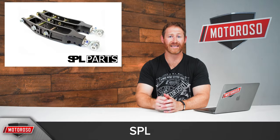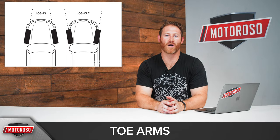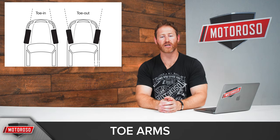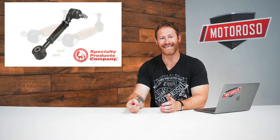The last control arm option comes from SPL, made out of T6 billet aluminum — light and very strong. These provide three mounting options for the sway bar end links and shocks, giving you complete control over the vehicle geometry. They're targeted at high-performance track applications and will set you back around $630. If you've been playing with camber adjustments, you'll also need to make toe adjustments — otherwise the car won't roll right, you'll scrub efficiency, and burn through tires. Great toe adjustment options are available between $200 and $400 from brands like SPC, Whiteline, and SPL.